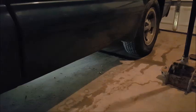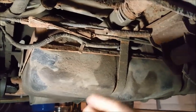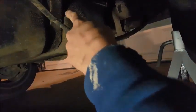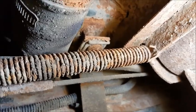The fuel tank is on this side of the vehicle — you have your fill port there. Unfortunately, this is the ugly part: you've got to go underneath the vehicle, and there's not quite enough room, so you have to jack up the vehicle to get to the fuel tank. This is the fuel tank, and this metal strap here holds it up, and there's one more metal strap right here that holds it up. Those are held in place by this bolt — there's a bolt head right here, and then there's a nut up there. In order to get this strap off, you have to bring that down.